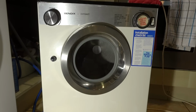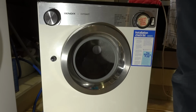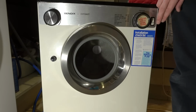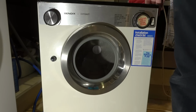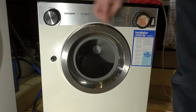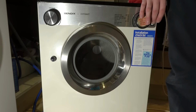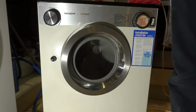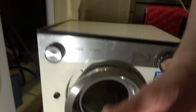And the other thing is, of course, with this, obviously there's no fabric softener. So what could have been ideal is after the 4th rinse, drain and switch off when this button is down. And then you could have just flicked it on after you put detergent in, put the fabric softener in, flip the button on and it continues. Or you could have even just kept the button down and then that ends the cycle. How cool is that? But no, they didn't do that, and I think they missed a trick there. But other than that, in terms of build quality, brilliant. Except getting this top panel back on, which for some reason has now decided to not fit again.